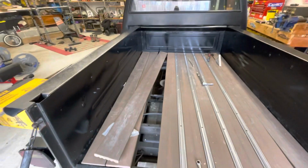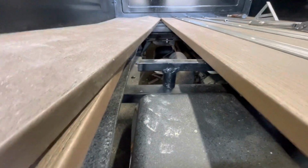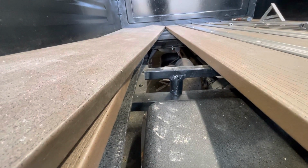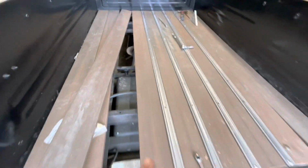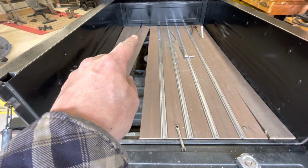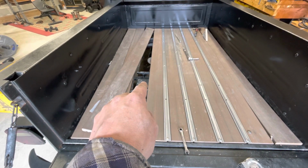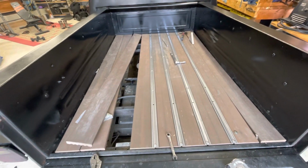I made a structure piece here, painted it black. It's a socket welded to a piece of square tubing. And I did that because when I stepped, I have a support here, and then I don't have another support until way down there. So it needed something else here, and that's removable. That's why I welded a socket and I put a bolt on it. This is welded and that side's welded, so there's a lot more rigidity there.